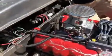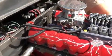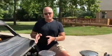torque converter that we got from Circle C Industries in Houston. They make torque converters for the same big monster trucks and mud trucks. So this is a giant Dodge torque converter that's tighter instead of looser. So this torque converter is all in at about 650 RPM instead of about 1,100 RPM, and that way it won't slip into gear running down the highway. The torque converter is good for 2,000 horsepower continuous with a 1,000 horsepower nitrous shot on it, so it's a 3,000